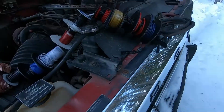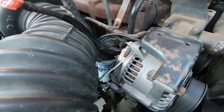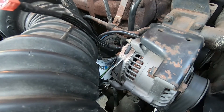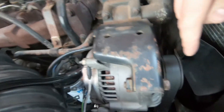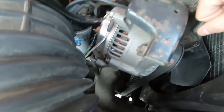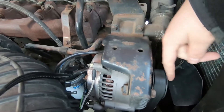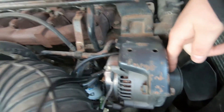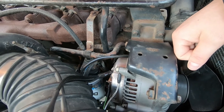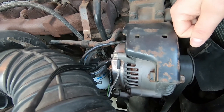When you're using an alternator-based tachometer, there are a couple of different things that are going to affect your RPM measurement. The first one is the ratio between the alternator pulley and the crank pulley, and the second is the number of poles that your alternator has. This is not a factory alternator — as you can see it's only a six-rib — that's the way I bought the truck. So we're kind of going to guess where our RPMs are until we can get it calibrated and really get it dialed in, but I think we'll be able to get it pretty darn close.